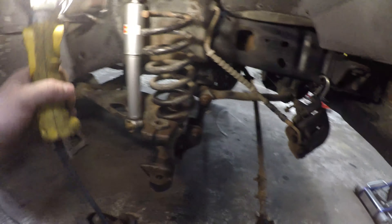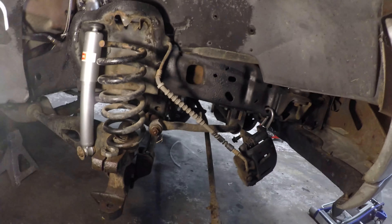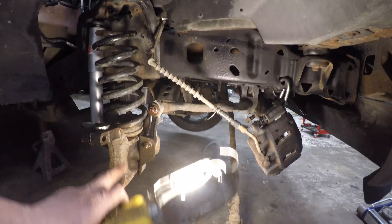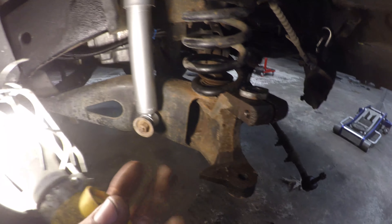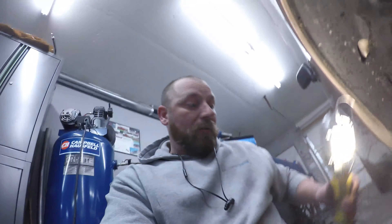There's a nut inside the spring — I gotta get that nut off, pull the spring off, and then there'll be another nut underneath that'll pull a bolt that goes the full length of that I-beam. It goes through this trailing arm here, up through that I-beam, and we'll pull that out. Then there'll be a main bolt on the I-beam up inside where it pivots from, and then that I-beam will fall right out — in theory.